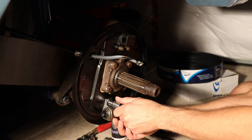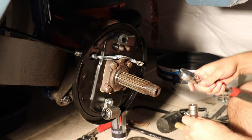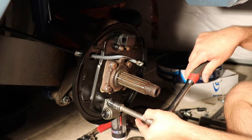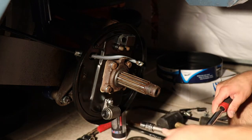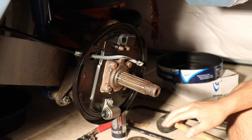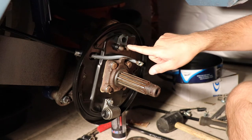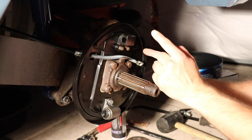This is a brand new screw — it came with a wavy washer. That wavy washer is kind of like a version of a lock washer. Old Volkswagens will generally have wavy washers. I'm just going to tighten that until the wavy washer is about flat. There is a torque spec; I don't know it off the top of my head, but as long as it's tight enough but not too tight — 'Guten tight' is about right. I'll spare you the anguish, but there's not much room on this specific backing plate to install the nuts underneath this block, so I'll fast forward to when this is already installed.